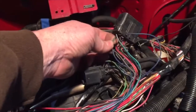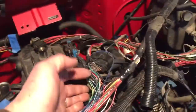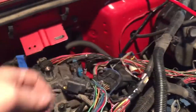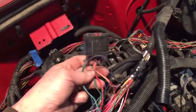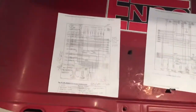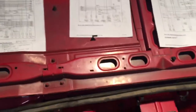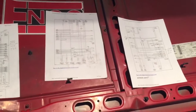The wires that came into these plugs I will be reusing and tying into the system. Some of them will just be tied back into here going on to the dashboard, and some will tie into the new PCM for the LS motor. I'm going to identify these wires and delete the ones I don't need. Some go back to the distribution block, those will be easy to find. Some go off up under the dash, so those will be tougher. I have the wiring diagrams right here - this is the PCM all the way over, that is the C3 plug, and then I have the distribution block.